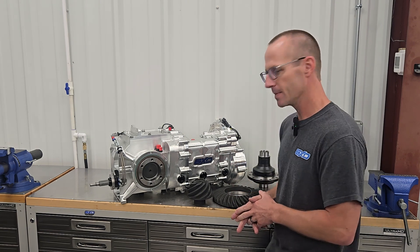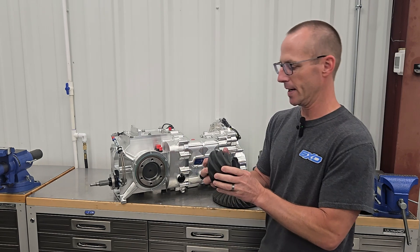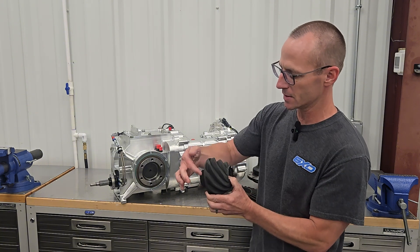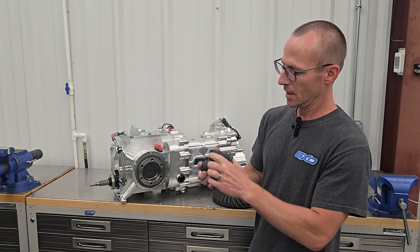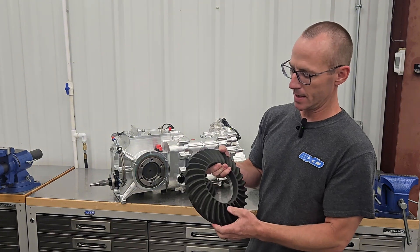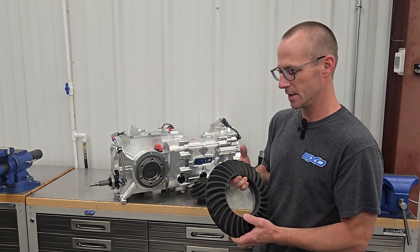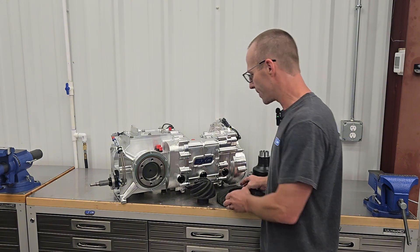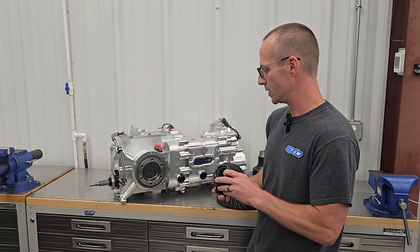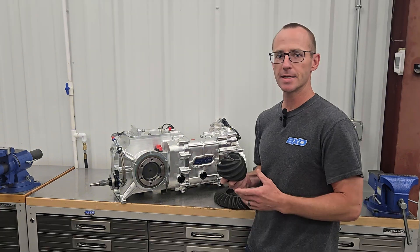He's got crazy results out of this ring and pinion design, and that's why we chose to go with it. This is a 10.6-inch ring gear. Just to give you a look at the way it's designed — these are actually machined on a five-axis machine because you cannot machine them in a conventional way, as there's a flange that goes all the way across the rear of the ring gear so the teeth cannot deflect. The same idea is incorporated on the ring gear here — a flange all the way across connecting all the teeth together so they cannot flex. The efficiency and strength there is incredible. On top of that, this is a high-hypoid offset gear, similar in concept to a nine-inch rear end — obviously much stronger — but you get way more strength out of your ring and pinion with a high hypoid offset versus a standard bevel gear.